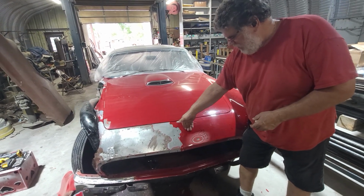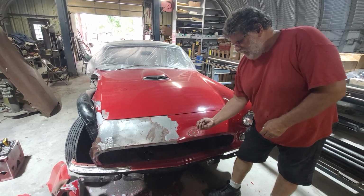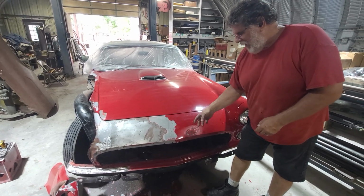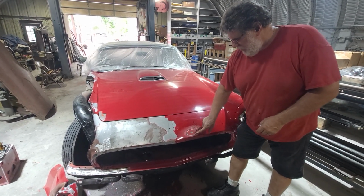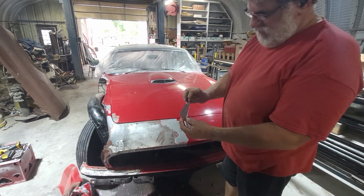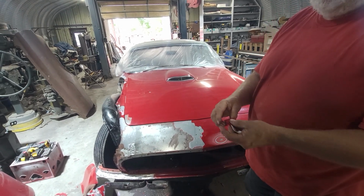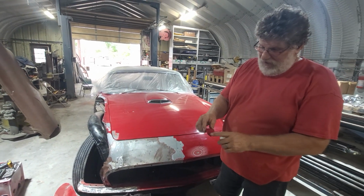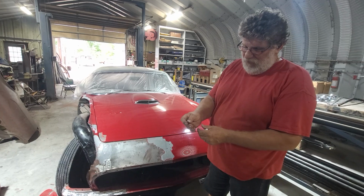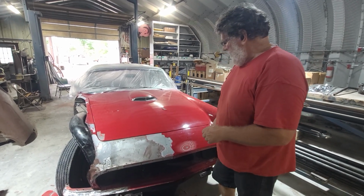It makes like a skin, like a piece of saran wrap, and it doesn't allow the fumes, the outgas, to come out of that. So all these layers underneath stay wet, and it's evident when you pull some paint off, and it's still rubbery. This car was last painted in 2009, and you still have a real rubbery paint surface. So there's way too much paint on here.